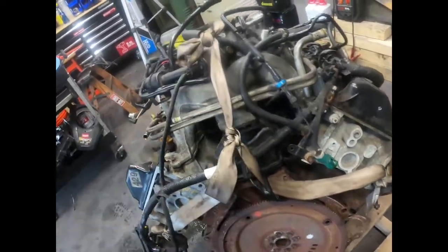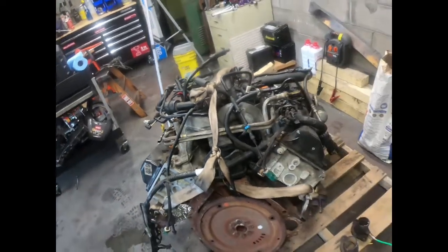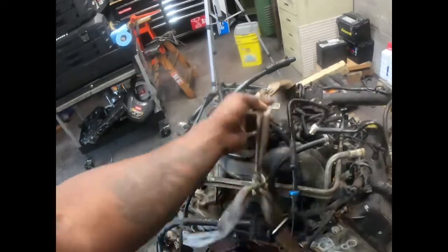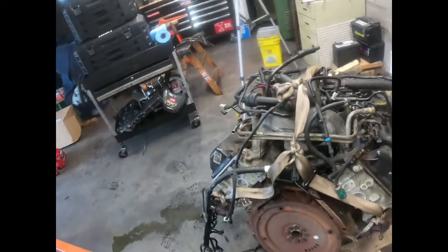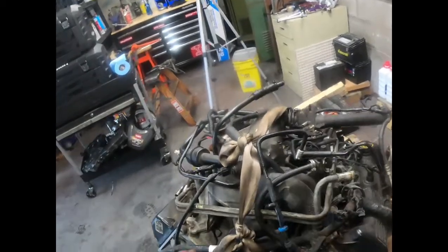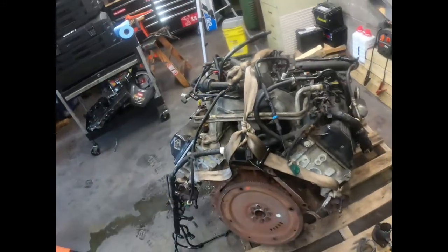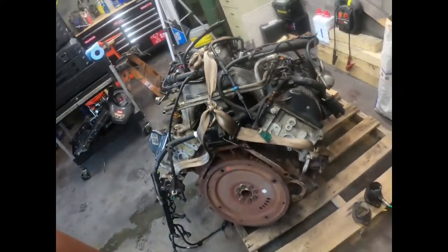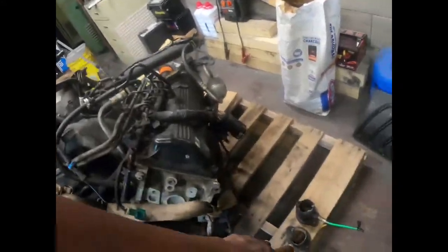But I gotta take this intake off anyway, so I can use the engine hoist, because y'all know they got a seat belt. The jack use it, but we ain't gonna be using that. The proper way to do it is get it from this bolt and that bolt over there, or from 2 side bolts, and lift it up with the chains. So you gotta take the plenum off anyway. He gotta order new intake gaskets. We already been taking stuff apart.